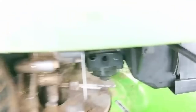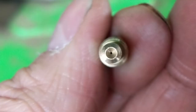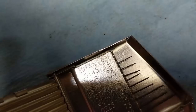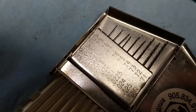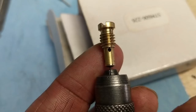Here is the hole that the pilot jet goes into. I'm going to use my micro drill bit set and oversize that hole by about one or two thousandths of an inch. Using the micro drill bit set, I can measure what size diameter hole it is — that hole in the pilot jet is 0.0135 inches, which is 13 and a half thousandths. I'm going to go up to about 16 thousandths of an inch. There are three holes on this pilot jet, so you want to drill until you can see the drill bit inside that top hole. I'm using my hand chuck for this.